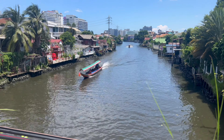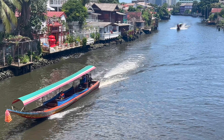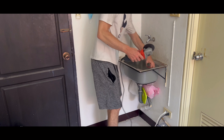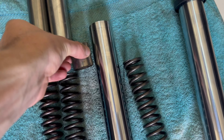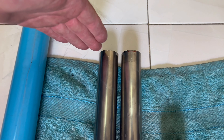On this river you have this kind of boat — sometimes Thai people use it, sometimes foreigners. Now I am at home. You remember the new springs were longer, so I'm going to cut 40 millimeters off. I put some protection and cut on the line. It's good — I cut right on my line. You can see the difference: I cut this piece and now they arrive at the same level.